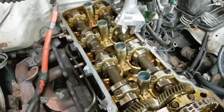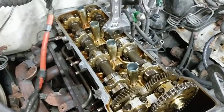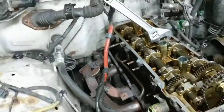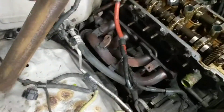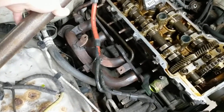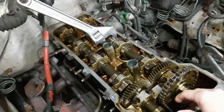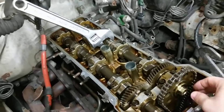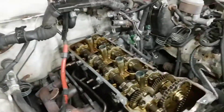The instructions tell you to use a wrench and hold the camshaft at this point right here. You can do this — I even set it up with a short piece of pipe braced against the fender — but the problem is the camshaft will flex and you'll get pulling on the bolt. You can actually see the part move a little, and I don't like that. It didn't feel good to put that much torsional force on the camshaft, so I abandoned that pretty quickly.